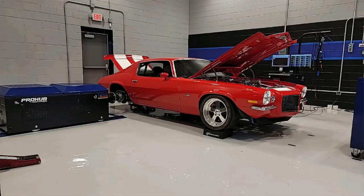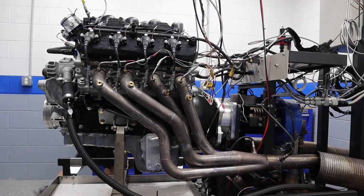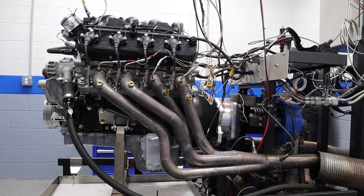On a hub dyno it's more controlled — they can actually control the rate at which you accelerate the vehicle. The hub dyno is kind of the end-all, super good way to do it other than going to the track. With both chassis and hub dynos you're testing the entire vehicle, so if you've got a wiring problem or a fuel delivery problem you can pick that up before you go to the track. The water brake dyno here measures the output of the engine itself.